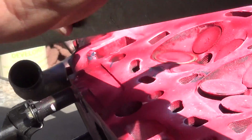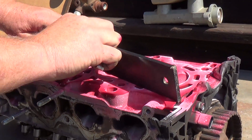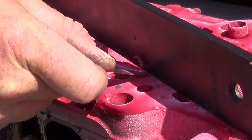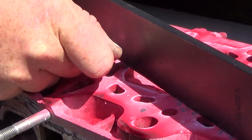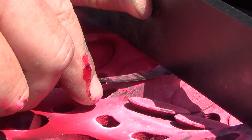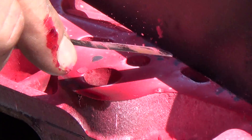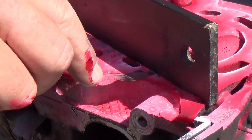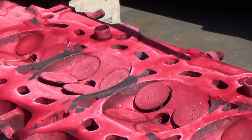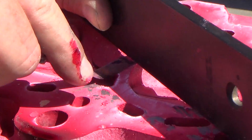I'm afraid we're going to have to have our head machined. Going the other way now — tight, tight, tight, and right there it goes through with no effort at all — no effort, no effort — then a little bit of effort, then it won't even go through. This head in these two areas is definitely warped. It probably warped right on these two cylinders where we were leaking coolant.